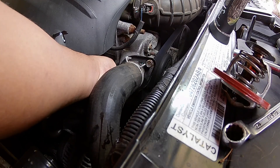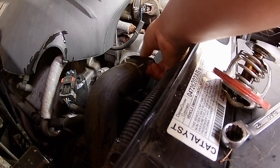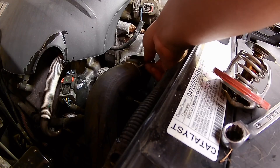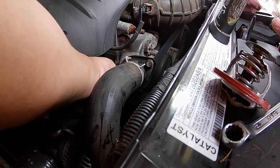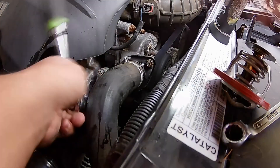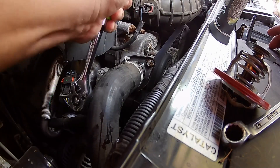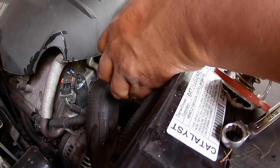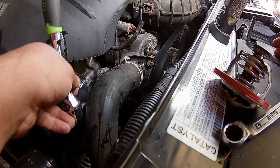Okay, they're both started by hand. Make sure you have a catch pan at the bottom to catch any coolant, and once you secure these up, go ahead and top off your coolant system. Any coolant that ran down when you opened this up, you can just get some water and pour it over where you spilled the coolant. Run the top one down, snug the bottom one up, then snug the top one up — go back and forth until it's completely tight. You just don't want it going at an odd angle or cockeyed.